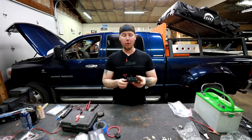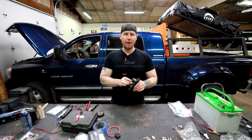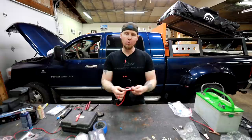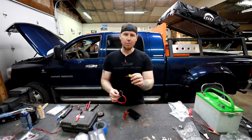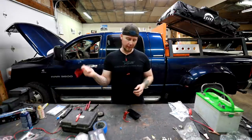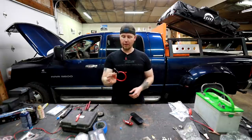The next system I want to hook up is just some power. I want to have three power ports back there — to hook something up in the rooftop tent, charge something in the bed, or inflate a mattress. This has a fuse style that I don't like, and it doesn't need a relay, but it does need a fuse. So I'm going to trim out the fuse it came with and install one of these blade fuse holders so I can use a traditional automotive fuse. I buy these in a 10-pack, keep them in the drawer, and whenever I need one I can just pull it out and solder it in-line. There are two primary methods to solder wires together: a soldering iron or a torch. I myself am a torch guy — it's very fast, very simple, and I'm very comfortable with a torch because I was a plumber for 15 years.